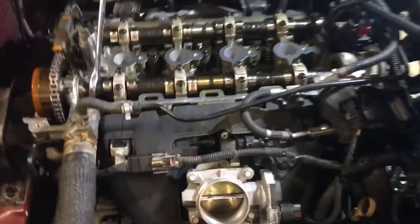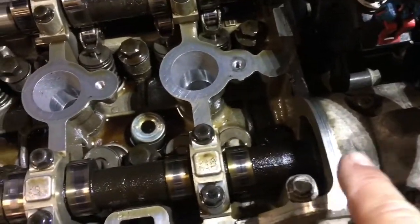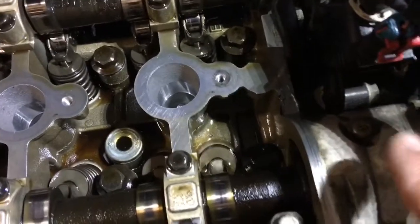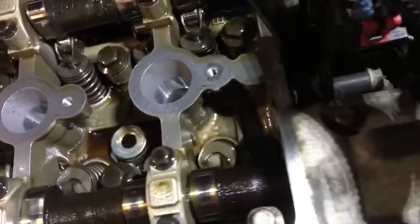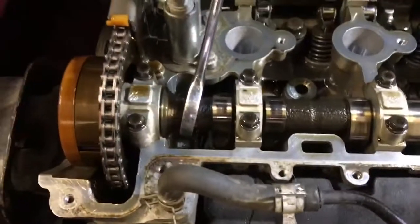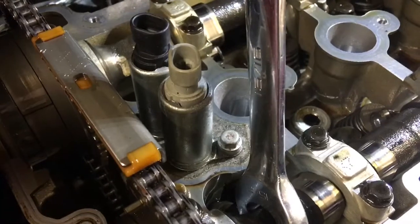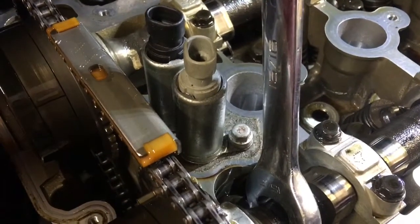The engine is in, and you have to change over the throttle body from the old LAF engine. You also have to take these three bolts off that hold the fuel pump and end cap assembly — there are three bolts there, and on the end there's also a cap with two bolts on it as well. The high-pressure pump comes off too. Then the sprocket goes on next — you have to reuse your old LAF intake cam sprocket, variable cam timing, and supposedly the actuator as well.